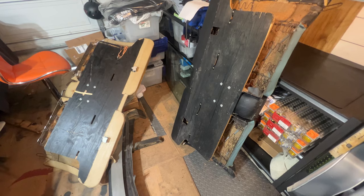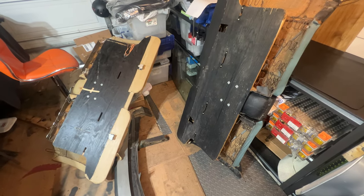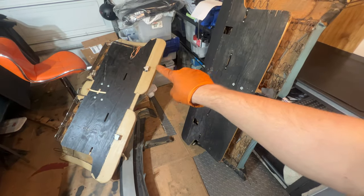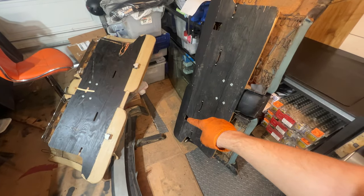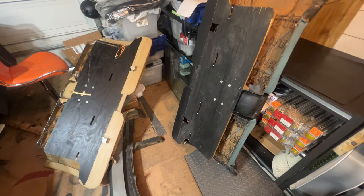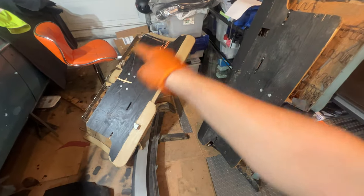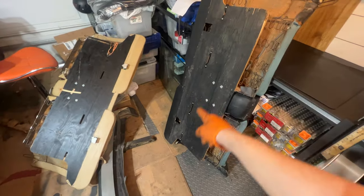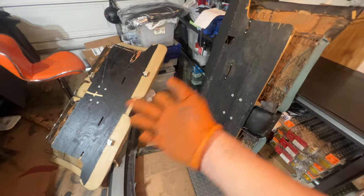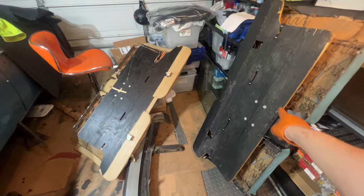And for the top seats, it looks like they're mostly identical. The one difference that I'm spotting is these two brackets here and here are just holes on this side. But these are the cutouts right there. You can see the screws for the rear headrest attachment. This has the same cutouts here from the 1969 car and the 1974 car. So more or less the same top halves. And these four screws here are what attach the central armrest.